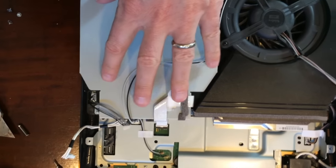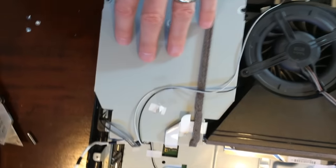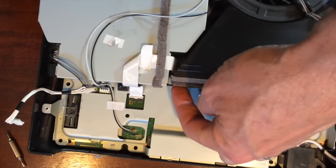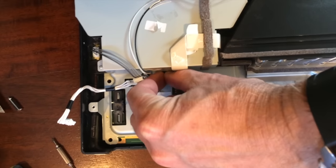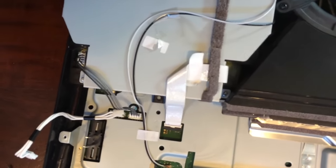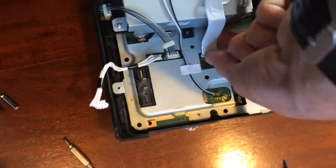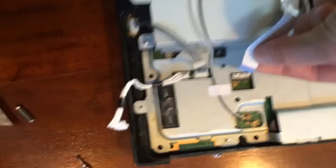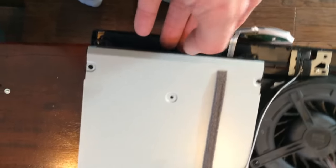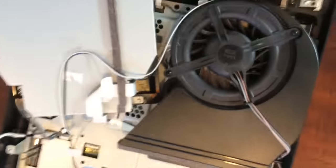The next thing you want to do is take this whole laser pickup out. The way to do that, you have to take off this screw down here and a little screw underneath here. The way to access that is to first take out this screw down here — I've loosened it, so take that one off first. Then basically the whole thing will just be able to move back. You'll have to just pop this out, and then actually just pop this one out for now. Like that. We can get some room to it.